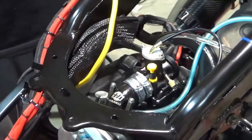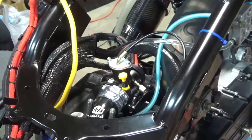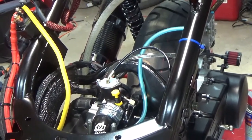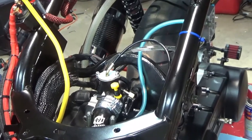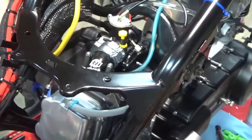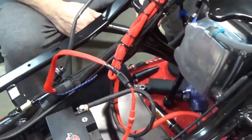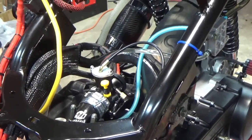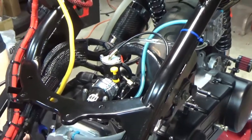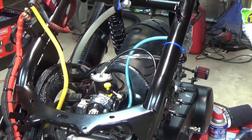All right, guys. I just wanted to do this live to see if everything worked out, and so far so good. The next video I'm gonna tune it, and I think what I'm gonna do first is tune it by ear, and then from there use the air fuel ratio sensor, and we can actually see, because I have a display. So we'll have the display up and you'll be able to see when I'm tuning and whether I need to adjust any of the jets or adjust the needle jet. So yeah, any of the jets.